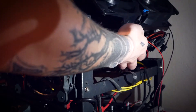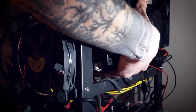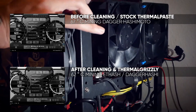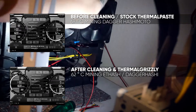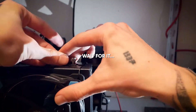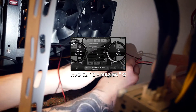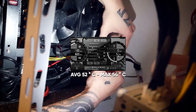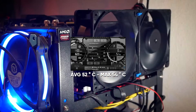This is our beauty — yes it is ugly, yes it is big — but I really wanted to test this so let's do it. Mounting is no problem in the open air setup and we still have enough space. In the last video we went from 67 degrees Celsius down to 62-63 just by reapplying thermal paste and cleaning the card. Now we are at 52 degrees Celsius, which I think is amazing — another 10 degree drop.